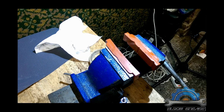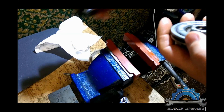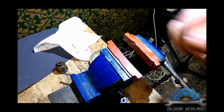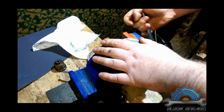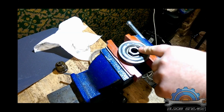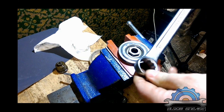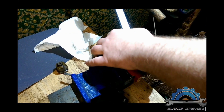You can do a rattling fix yourself without any special parts. You just need something to secure the piston in the vise without scratching it — not too tight. It's also recommended to use an impact gun or impact wrench, but if you don't have that, you can create an impact on your own using a 24mm spanner and a hammer.